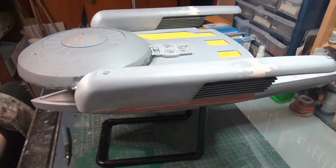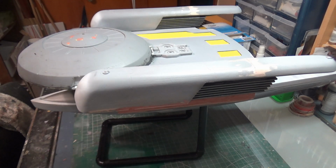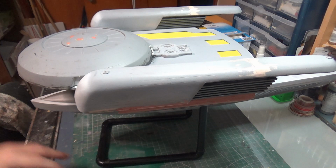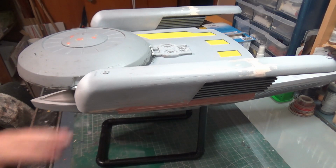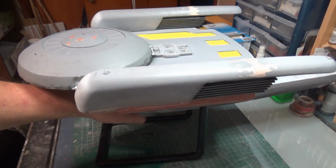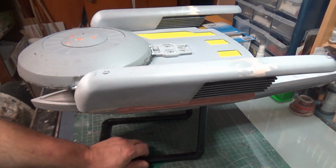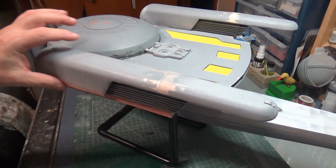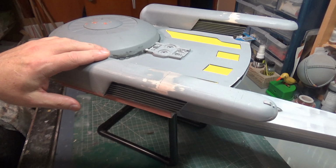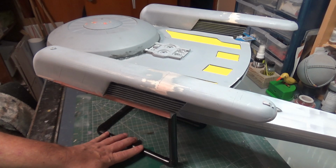Now, a quick outline of the next few steps. I want to get the JB Weld from yesterday sanded down and cleaned up. Replace any window masks that need to be replaced. I also want to get some wide transfer tape and protect the areas that I've already painted, this area and under here and under that top deck, because we're going to start doing the painting. I want to get the bodywork done this week, and then we can start off Monday with the painting next week, and that includes getting all of the primers on here, getting the edges touched up where there might be something that still needs to be addressed, so that when we're ready to hit this thing on Monday, it will be to put the final coats of paint down.